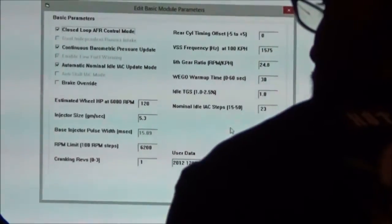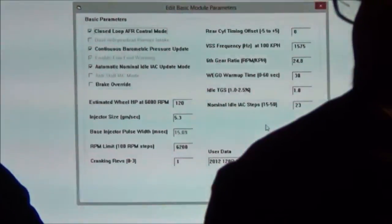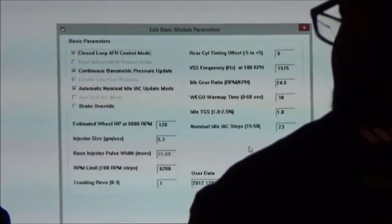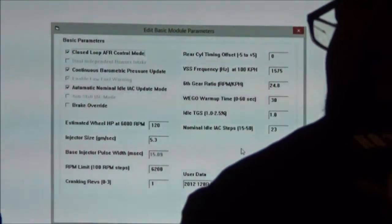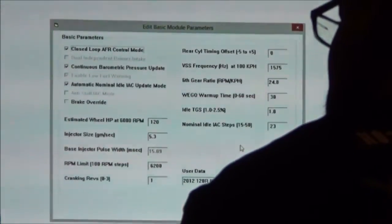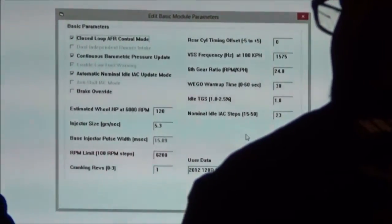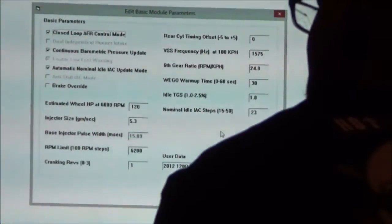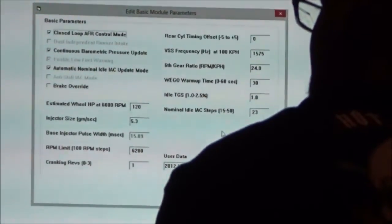What does it do? It cuts the spark off until the system figures out phase. It takes two revolutions for the system to understand what's going on anyway — that's where our cranking delay kicks in. So if you've got a high compression setup with a real early intake close on a cam — 232 or 236 duration, short stuff, 34, 36, 38 degree intake closes — when you start getting over about 190 to 200 PSI, that's when you want to start playing with that setting.